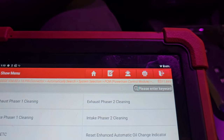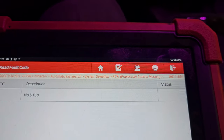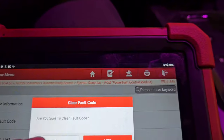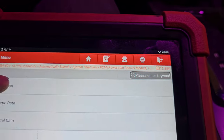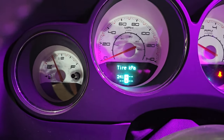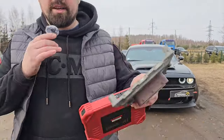Before you do all this you don't have any accelerator pedal response at all. Now go backwards and read fault codes — DTC information — and the DTCs automatically go off. But if not, just to be sure, go back and press clear fault codes. Clear fault codes — completed. Read fault codes — DTC information — no DTCs. Now just start the vehicle.